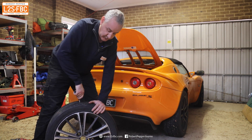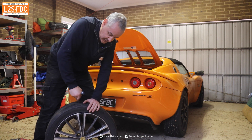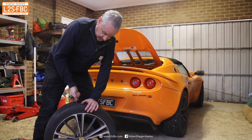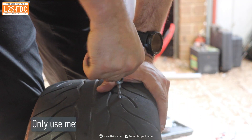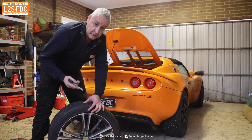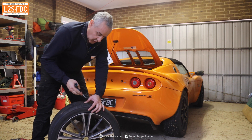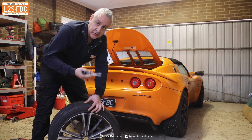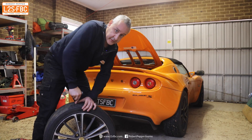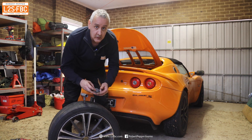You're opening up that hole so the plug fits in. It feels weird that you're making a hole bigger, but that's basically what you're doing. Once that's made sufficiently large, pull it out. What I would do at this point is actually leave the reamer in there, because that will plug the hole temporarily and stop air escaping — that just means there's less air to blow up later. So I'm going to put that back in while we do the next bit.